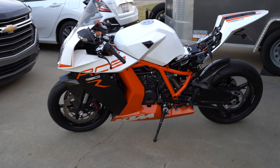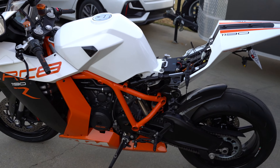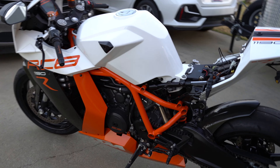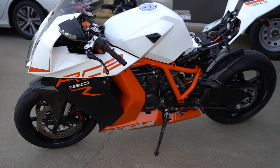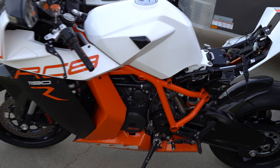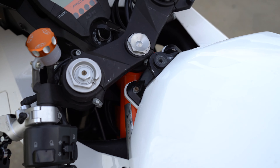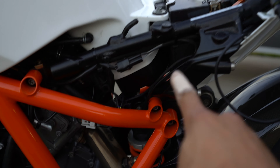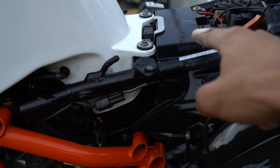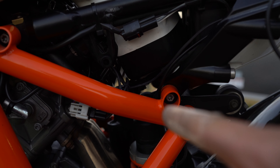We're outside — I finally got everything buttoned up. For those of you with an RC8 wondering how the Annitori quick shifter goes on, here's a quick rundown. First, the tank has to come off no matter what. You've got two bolts in the front and two bolts in the back. The side panels pull off — they also have a screw in there. Then take off the two hoses on each side of the fuel tank, and disconnect the main fuel line underneath.